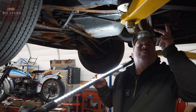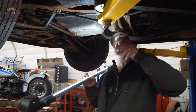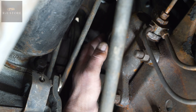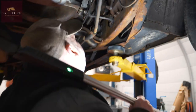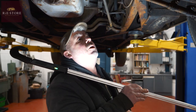Well, the brake pedal and the clutch pedal are out of line — one's a lot higher up than the other. We can adjust all that; that's easy enough to do. The plate that goes on the floor — there's a plate on the outside and a plate on the inside, and none of it's bolted up. Obviously somebody's had a play around with the pedals, but you can adjust them all. I'll just adjust everything up properly how it should be.